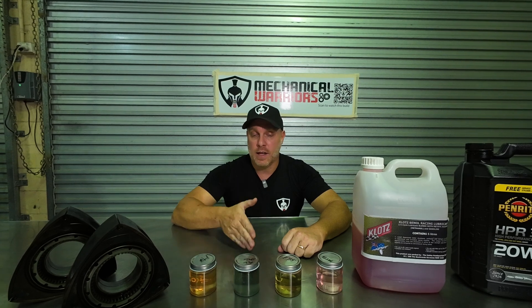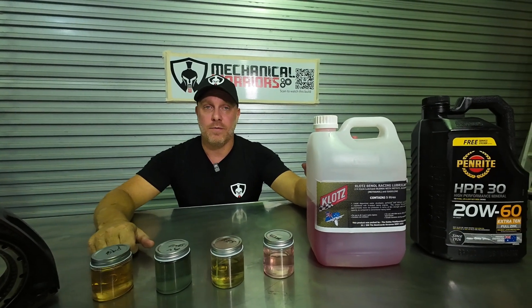Go through all that information, work out what it is you want to do with the engine — whether it's street racing, an everyday driver, or drag racing — pick your goal, then select your fuel type, fuel system setup, and lubrication system to suit. However, even if you're just an everyday driver, I would always recommend getting rid of the oil metering pump and pre-mixing your fuel, as it is the safest method of lubrication for a rotary engine. Thanks for watching everyone, we'll see you in the next one.